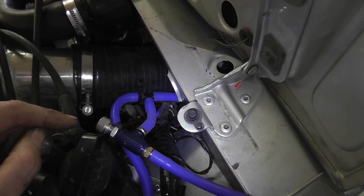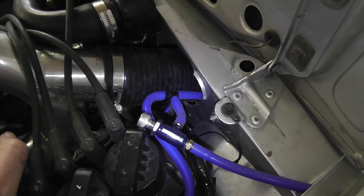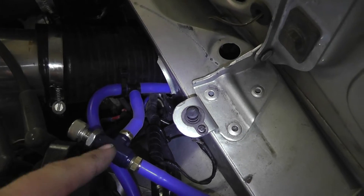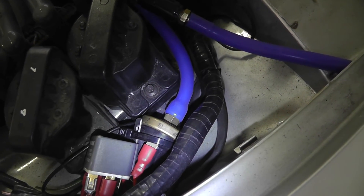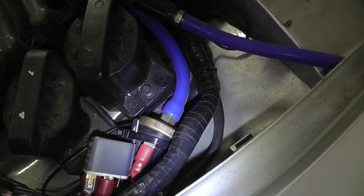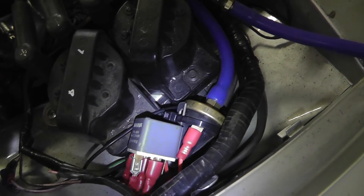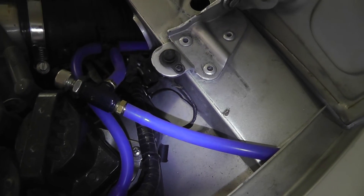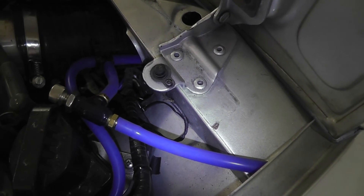There will be a slight disadvantage of not having the valve fully open immediately — it's like closing your throttle. I also have to turn the supercharger off at that exact point. What I've done is taken the ball valve and plumbed in a Hobbs pressure switch, which would normally turn the supercharger off right from the get-go. That's normally open, so I've used a relay to reverse the logic so that when the bypass valve sees 10 psi from the turbo it will also turn off the supercharger.